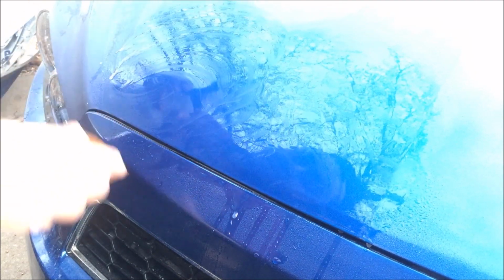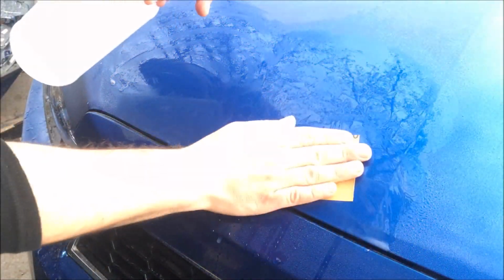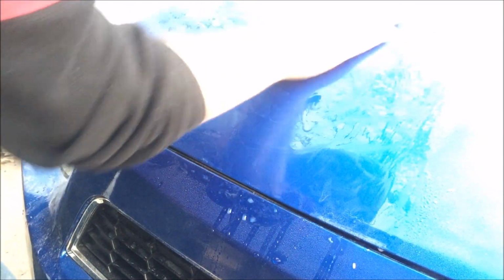And the idea basically here is with 500 we wet sand it. 500 grit basically makes it flat, and then 800 to 1000 grit removes all the scratch marks from previous wet sanding. Then we will move to about a 1200 grit that removes the previous scratch marks from high grit sandpaper, and then we'll move to 1500 grit, and then finish off with 2000 or so.